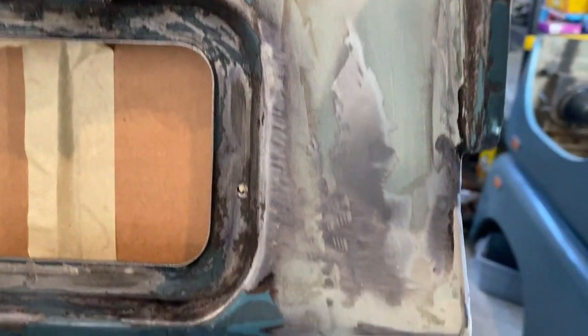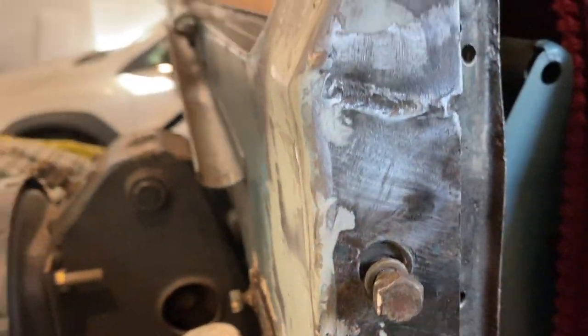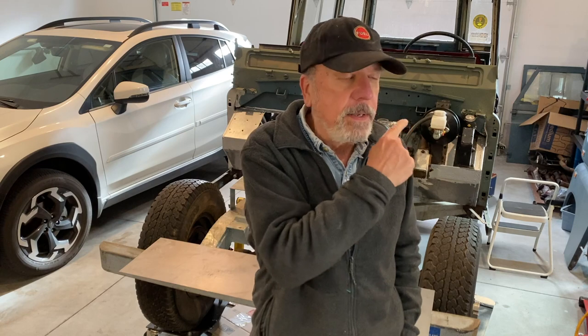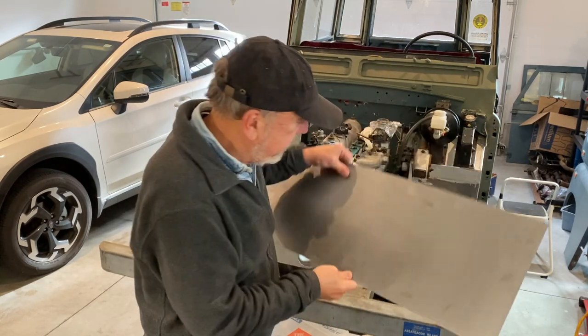So here it is. I've welded this all up and put a coat of Bondo on it to make it look better. I'm going to paint it up real quick, but it came out pretty good. I've put a bit of etching primer on — you can see it's pretty smooth, and I put it all across the vent seals. So that's it for today. It's under eight minutes, which is good. I've taken that corner and replaced it with the steel replacement part — it came out great. Along the way I did do some more touch-up welding, but I didn't include those in the video. The next step is going to be a little more difficult: using this piece of steel I just picked up from Metals Depot and reforming the tunnel cover on the inside of the rover. I'll be working on that pretty soon. Thanks.